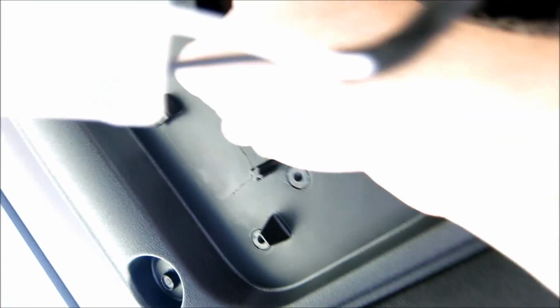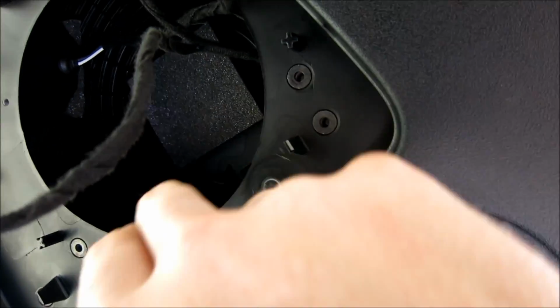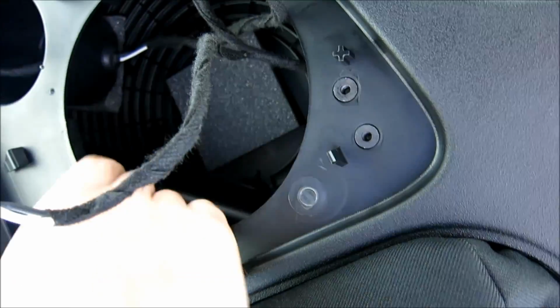Alright guys, so this is super cool. What they've done is they've actually made the tweeter port here, like the tweeter opening, sealed, and then this is sealed. So why are you like, oh that's so cool? The reason why is because then you're gonna probably get some better low ends and some better mid bass just from how tight it'll sound in here from being sealed.